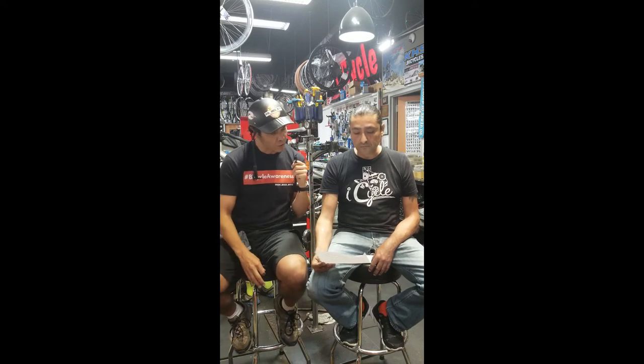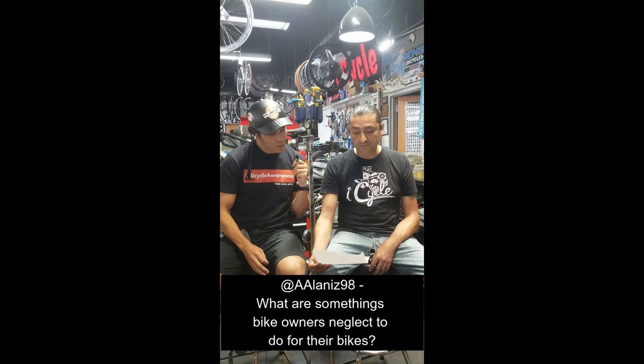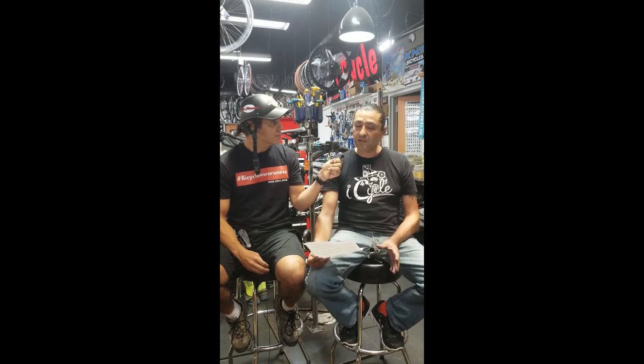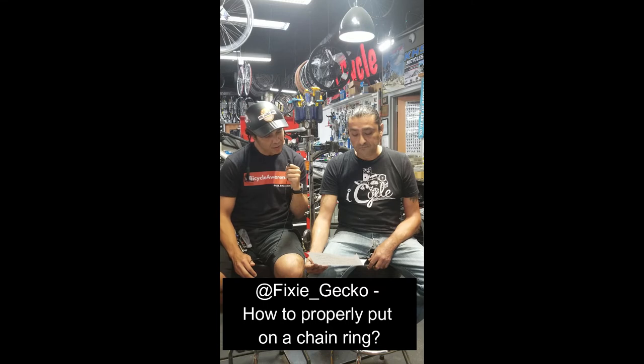Next question from Unleash 98: what are some things bike owners neglect to do for their bikes? Oil the chain properly. You see a lot of riders with oil tracks across their legs or their pants — that's because they either put too much oil or they just never clean it. Clean your bike chain at least once a month, and once you apply the oil, with a nice dry rag wipe off the excess. It doesn't have to be dripping. That'll make the bike run a lot better and not leave those ugly tracks. Also, check your air pressure every time you ride, or at least have a checkup once a year.